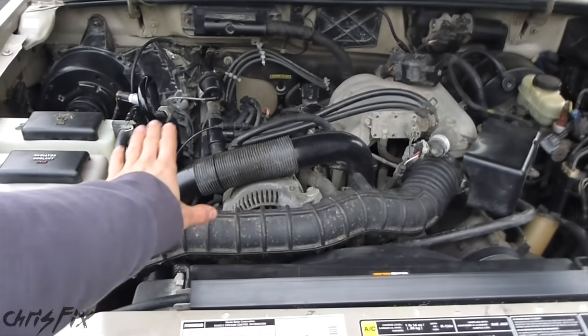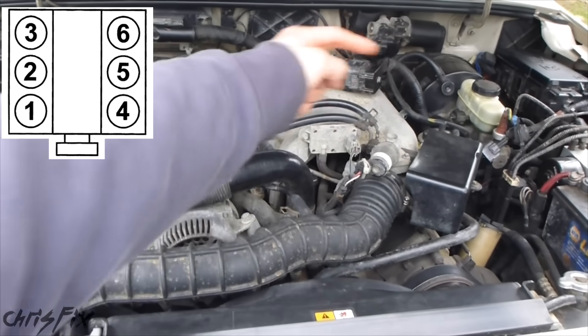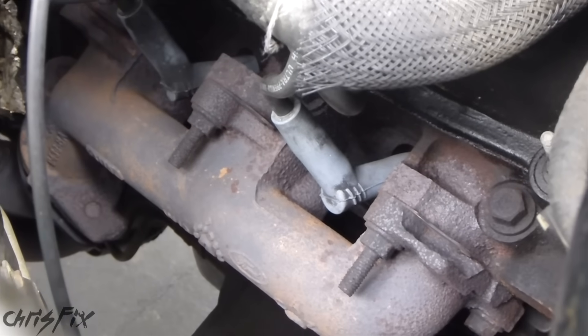For reference, we'll start with the passenger side and move to the driver's side. The cylinders are numbered 1, 2, 3, 4, 5, 6. Going into Cylinder 1 — you can see there's a decent amount of carbon buildup around the edges of the piston and also in the middle. This is what you would consider a typical amount of carbon buildup — not extreme, but not a little bit either. I've looked into engines with no carbon buildup, engines like this with some, and others with a ton.